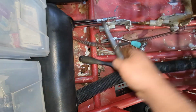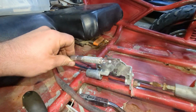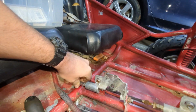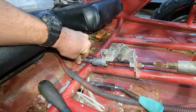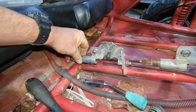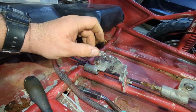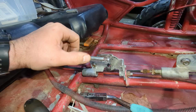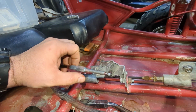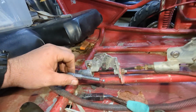Now we're gonna throw it on there in the stack. Put it back through the back here and see if that takes out a little bit of our spring slot. So we got that on there. Take this whole assembly and put it back through the back. And now, actually, that isn't right, because that needs to be able to slide over top of that to make the spring work. So I gotta drill that bigger. So now I gotta find the OD of this piece here to drill out that nut and make that work. I'm gonna double check what I got and see if I have something that'll make this happen, because I didn't think of it that way when I was doing it the first time.